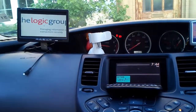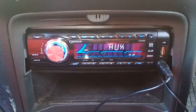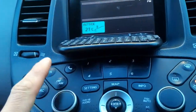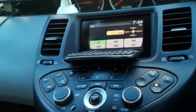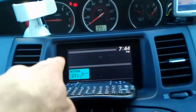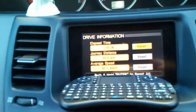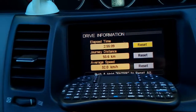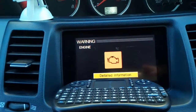The way I connected the audio in this Nissan Primera — I had to add a second audio player because the built-in Nissan one couldn't be connected to the amplifier directly. I also had to leave the old audio player in place, because if you remove it completely the screen goes blank and you lose all the journey information display.